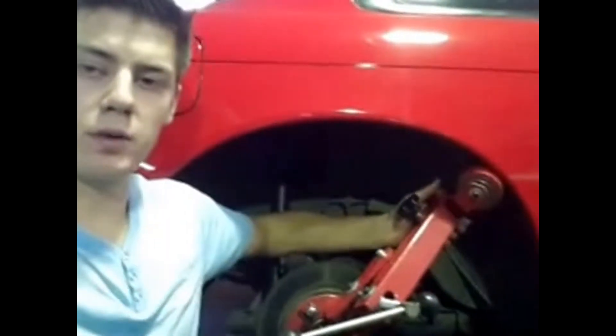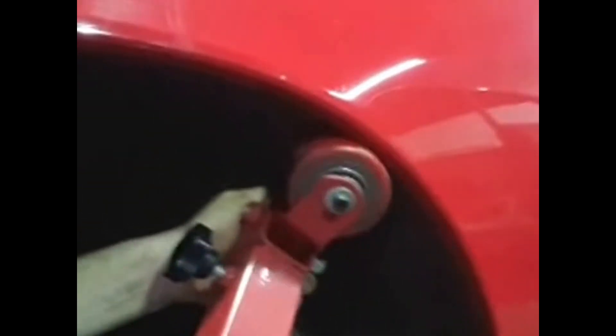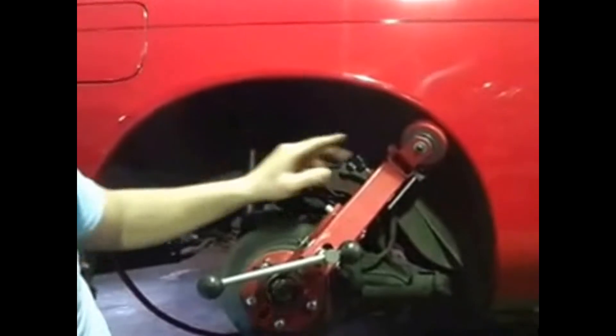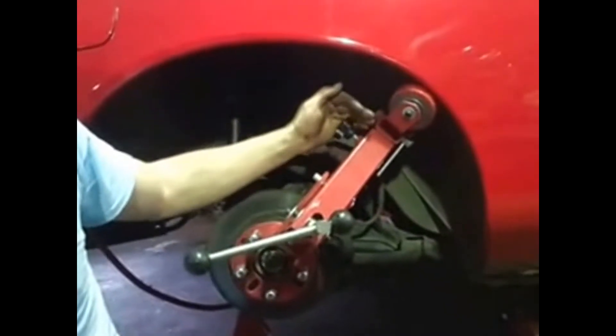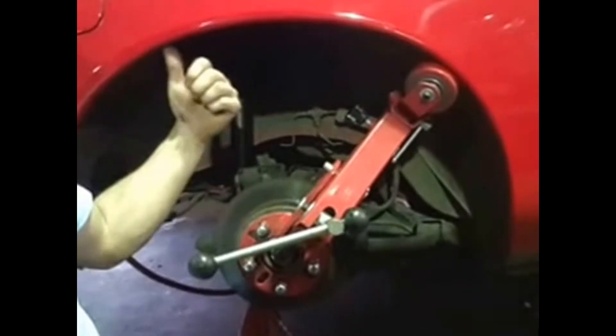Now that I have this thing fully adjusted in the place that I want, you'll see this is how you start rolling it - you can actually hear it going. Unfortunately with this car the radius of this fender isn't quite round, so what I'm gonna have to do is do as much as I can on this section, lower the angle, then do this over here, and adjust it again for the last section.